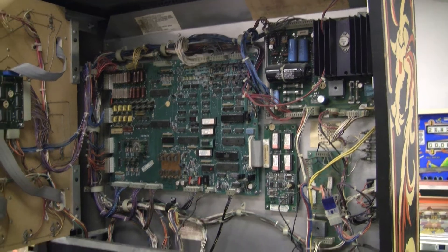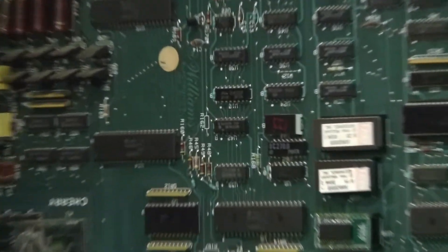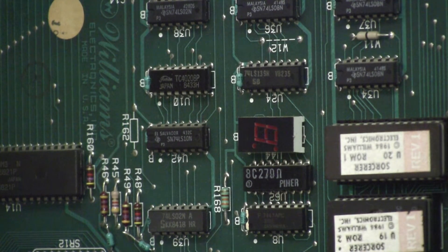When I booted this game up there's a little diagnostic LED. Let me see if I can zoom in on it. Right there — you see that? That had just the number one in it, which indicates that the game went to do a memory check error with the CMOS RAM and failed. So the game didn't boot up. During its self-check, it had a problem.